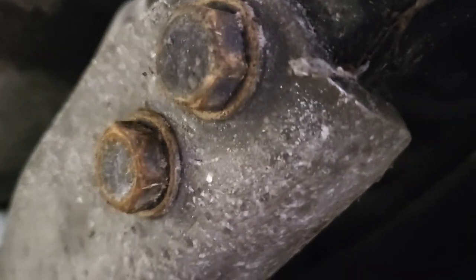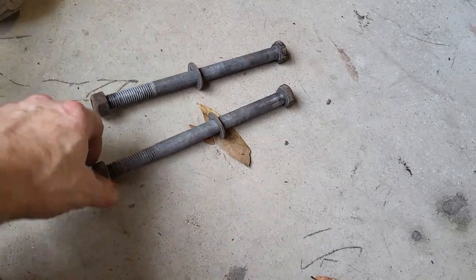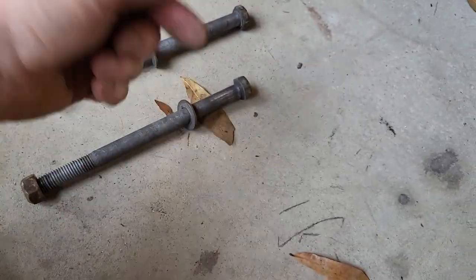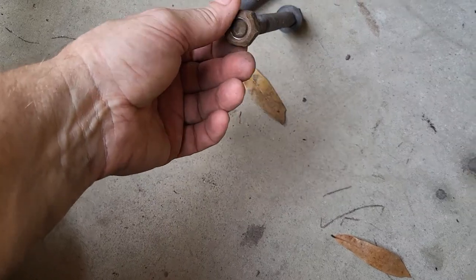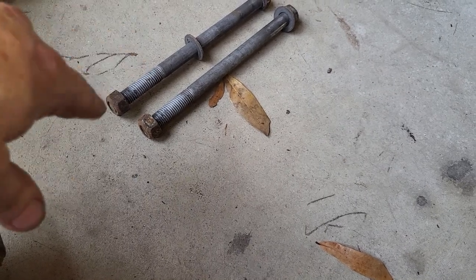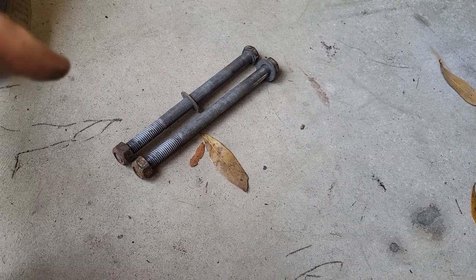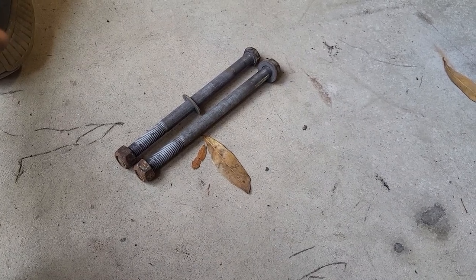All right, well, let's see what we got. Well, I got the bolts out of this thing at the rear end, so I've got to go up to the transmission and do it, but I had no idea. I just figured it was a short bolt that held it in there, but this thing goes all the way up through. I had to get a wrench up there to hold the other end, and there's like no room up there. So anybody looking to do this, getting those out is a little bit of a challenge, especially when you don't have a lift and you're just laying underneath there. Let me get over to the front end and get the transmission side up, and we should be able to get that long brace between the transmission and the rear end out of there. Then I should be able to get the drive shaft out.